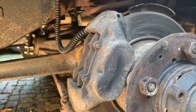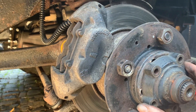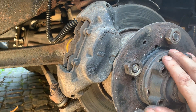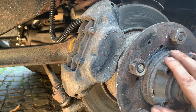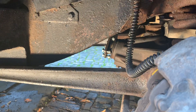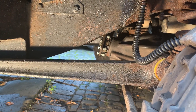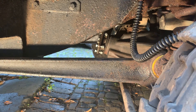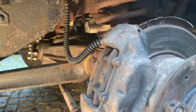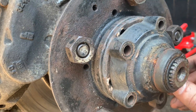Because I've got loads of play, that's our clunk — that's our knock when we take up drive on our Land Rover. This is a 1988 and this could be where your clunk's coming from. To diagnose it, I removed the front prop shaft, giving a two-wheel drive vehicle. With the transfer box output to the front axle not being driven, the clunk disappears — so I know the clunk is coming from this drivetrain.